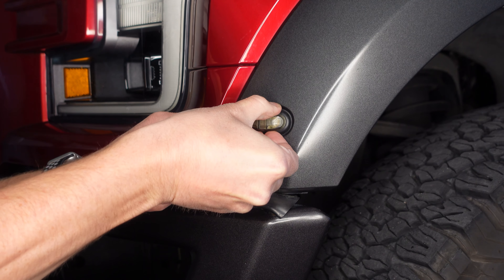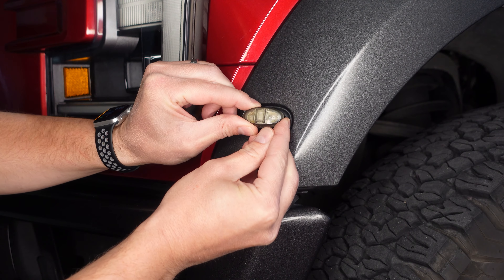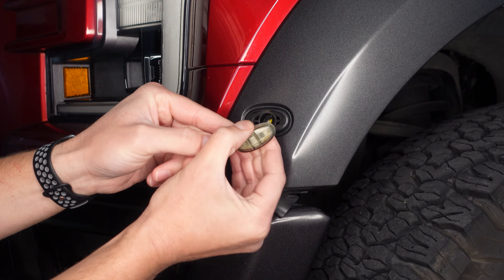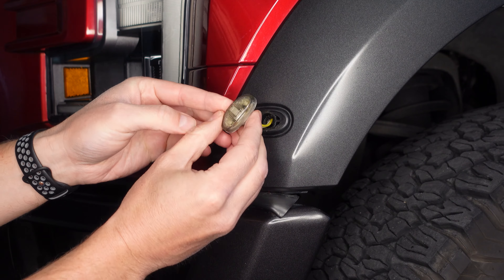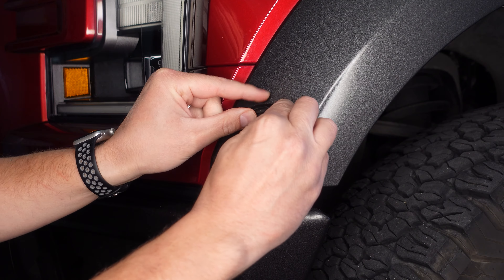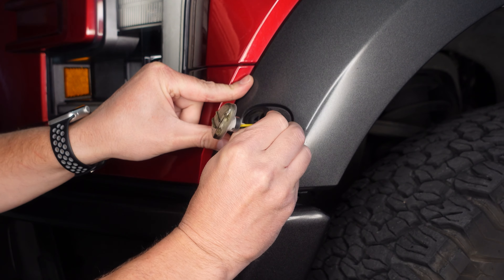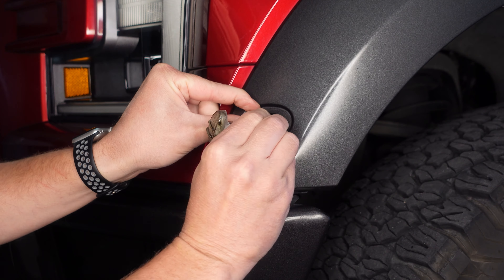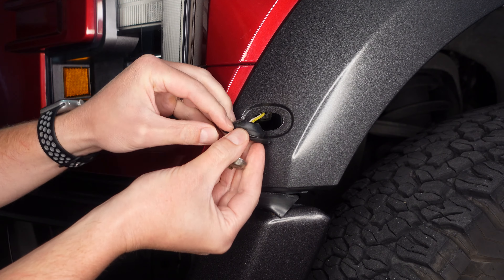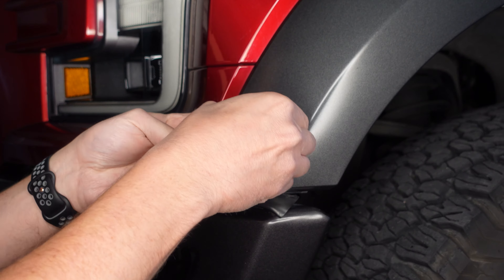Basically to remove it we kind of just pry it out of this rubber housing — just wiggle it back and forth with your fingers. So we've pried it out of the rubber; there's two wires going back in. With the light removed, it's a lot easier to remove the rubber housing. We can just flex this rubber housing — it's kind of like a grommet — and work it out of the hole. So we've got that, and you can see how it's just undercut just like a grommet, then we'll pull our wire out of the hole.